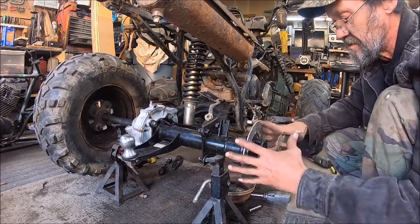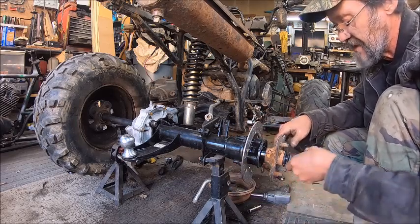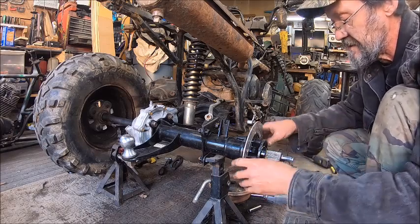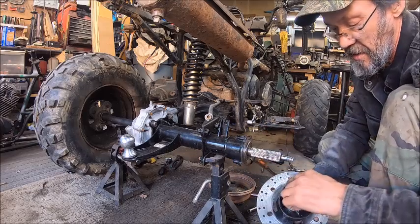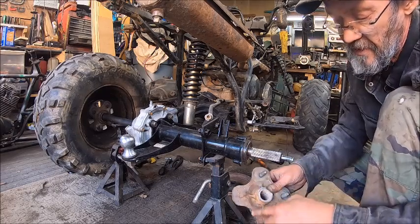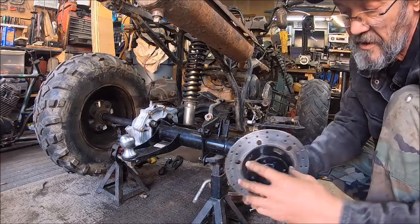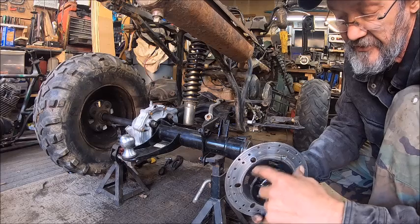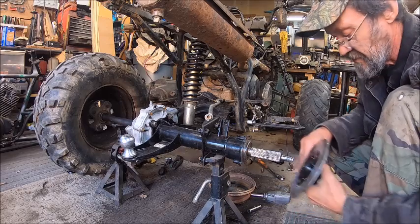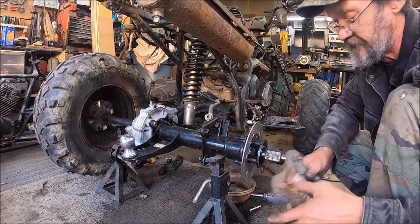And there we got our rotor system. Basically what I did was I went and bought a new rotor, or a used one, off of eBay, and I just cut all this off of it because it looked like that. And I just cut all this off of it, took it over to the lathe, and lathed the rest of it to where it came down to meet these standoffs where the threads go in that holds the rotor. That way we didn't have all this stuff here sticking out.